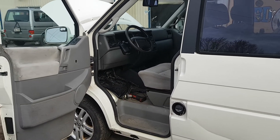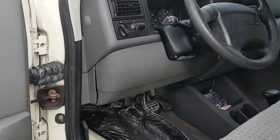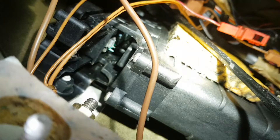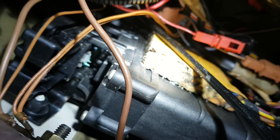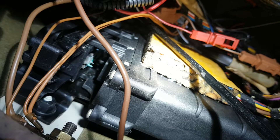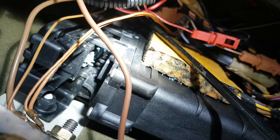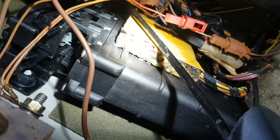You have no communication with your TCU but you have communication with all the other modules — something I've never seen before. But you can see the pins are right out of the actual unit, that's horrible. Let me see if I can get this thing to focus and snap a picture. That explains why it wouldn't go into overdrive or wouldn't go into fourth gear.